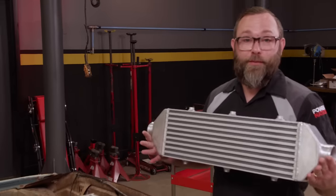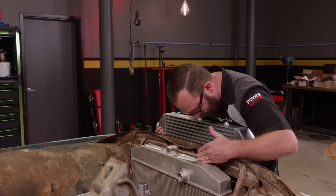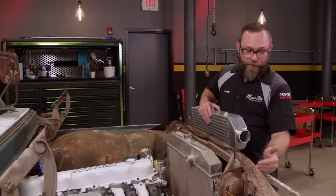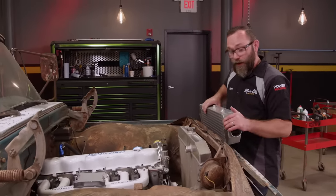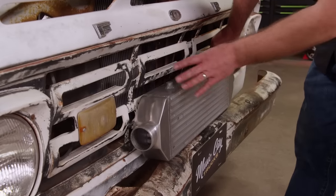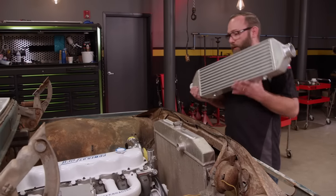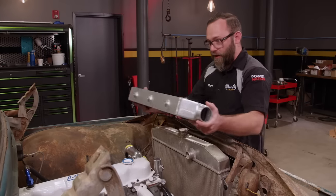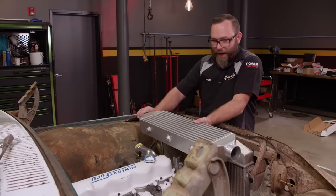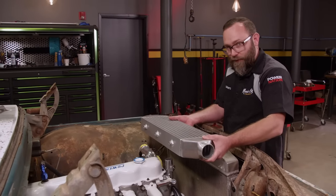We've got this air-to-air intercooler from Summit Racing. It's actually pretty small, but not small enough to fit in between the radiator and radiator support. And even if we did have one that would fit, we'd have to cut holes through the radiator support to get the plumbing run. We could mount it in front of the grill, but that looks kind of silly and the hose routing would be hilarious. Because there's a lot of room between the top of the valve cover and the hood, I think I can just mount it above the upper radiator hose, then plumb into it with a 180 and come right out toward the throttle body injection.